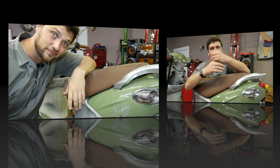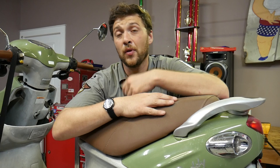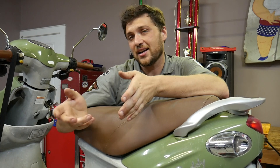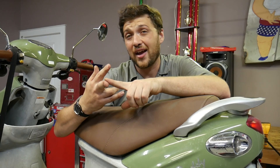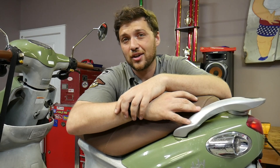And there we have it. So now we know the missing piece in this particular scooter was a charge of fuel and air. Even though I got the Victor Frankenstein moment of 'It's alive!', it doesn't mean that's the only result you need to pay attention to. Any signs of life at all — coughing, backfiring, even faster cranking — can be an important clue that you need to pay attention to.